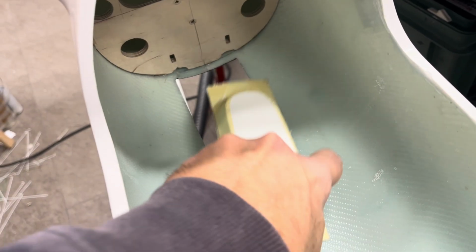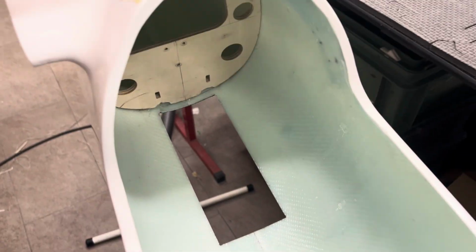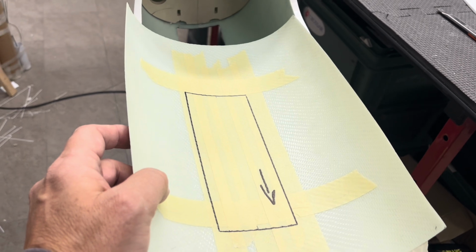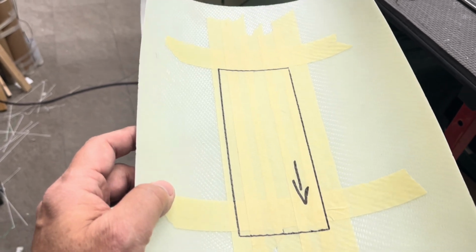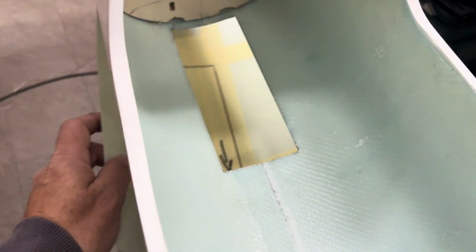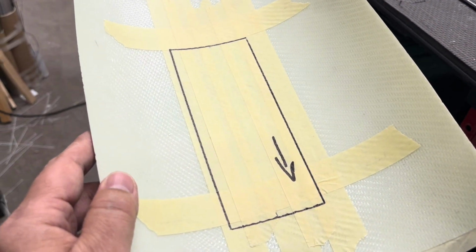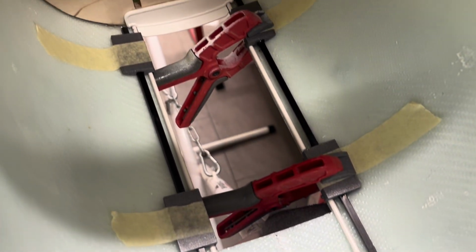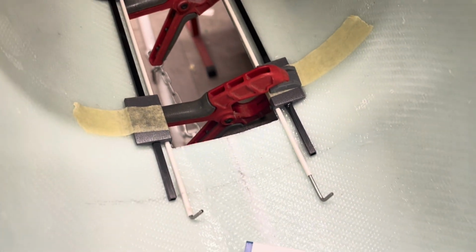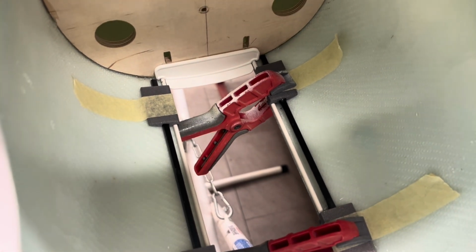Good. Since we removed the ASW15 landing gear, Airworld is providing a piece of fiber which makes the exact match with the fuselage on the bottom, and from below I draw the landing gear doors. Now I just have to cut the landing gear doors. I'm installing the Schambeck kit. It's all set with the reinforcement, the tube for the door, the hook as well to connect to the door. You will see in the next video what I will mount.